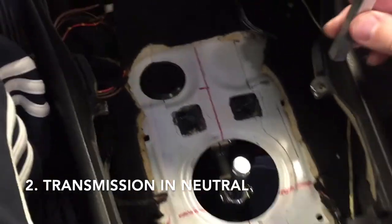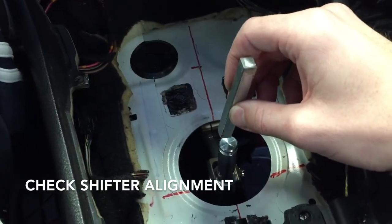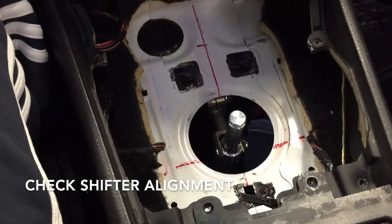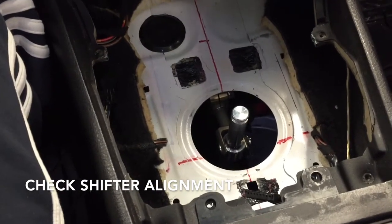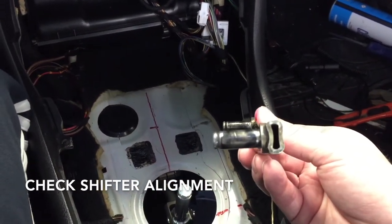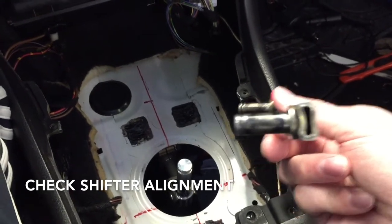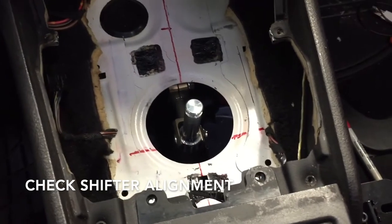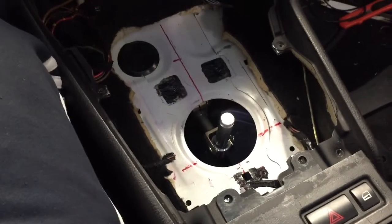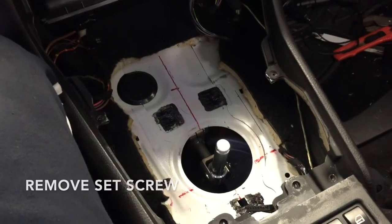Before continuing, you might note that your rotating assembly on the selector rod may be slightly rotated to the right. We gave you a preset earlier as suggested by CAE to set it perfectly square. If you look at the stock selector rod, you might notice that the pins are not in perfect alignment — they're slightly off. In our system, because it's set square, it's slightly rotated to the right. Because we have the CAE adjustable selector rod, we'll be able to take that out and make it stand perfectly straight up.